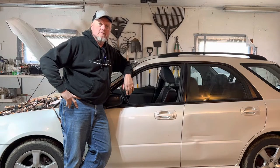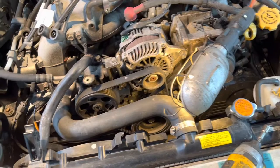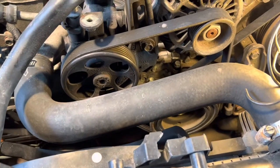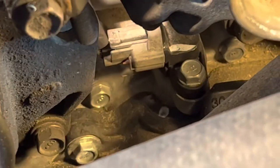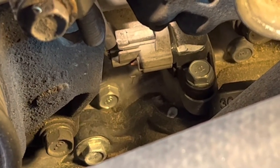All right, on today's episode of Pilgrim's Garage we're going to try and figure out why this thing wouldn't start at work the other day. So what I'm going to start on here is check my crank sensor. My crank sensor is right there — it's a 10 millimeter hold-down. What I'm going to do is pull that out and check impedance.